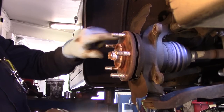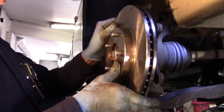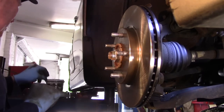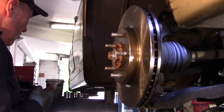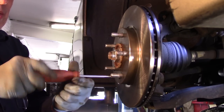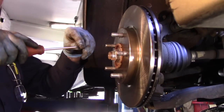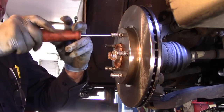Okay, now once you have it all cleaned up, we're going to put the rotor back on. We did clean this off with some brake cleaner. We're going to make sure the two screws line up the way they're supposed to right here, and then we're going to screw the two screws back in. I put a little bit of anti-seize on the threads so it goes in a little bit easier, and hopefully if we ever have to take them back out down the road, they'll come right back out without an issue.